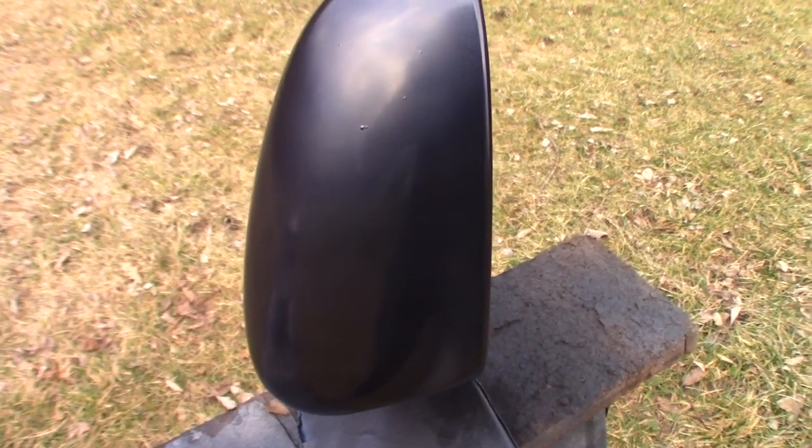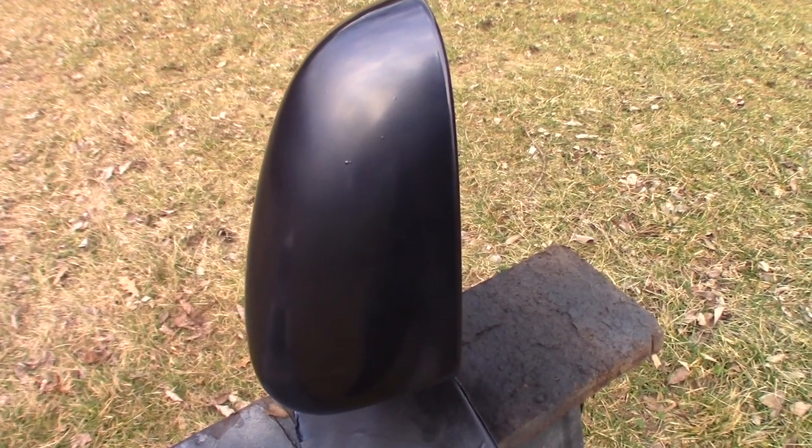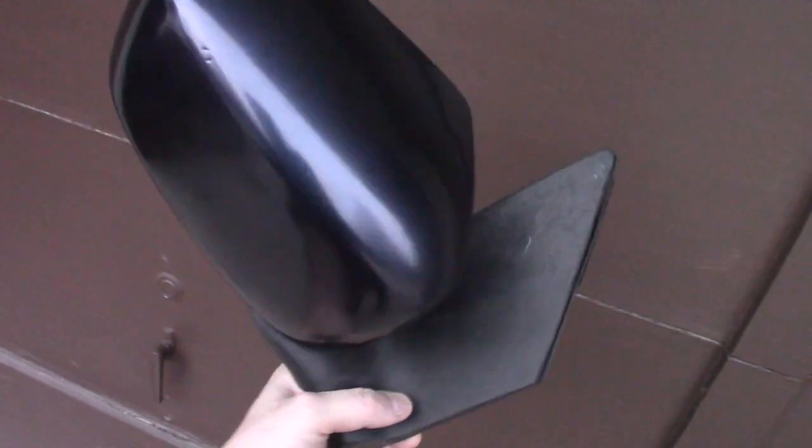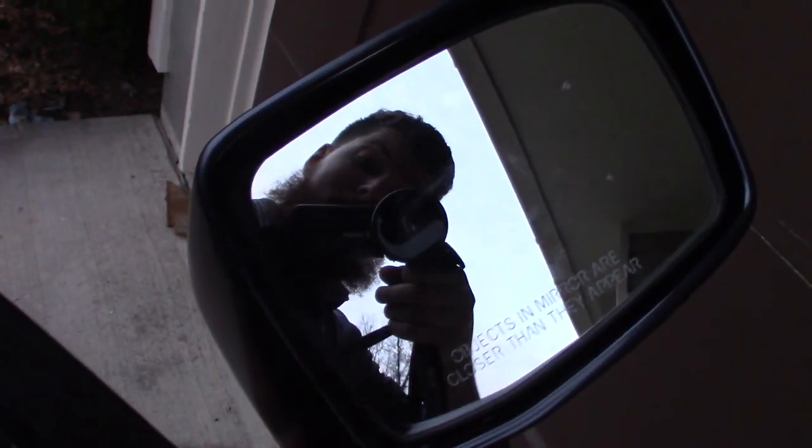Now I'm going to wait about an hour to let this paint cure a little bit before removing the tape — you want to do that before the paint is fully cured so it doesn't rip off chunks when you take the tape off. Here's the final product — turned out pretty well. This is not a bodywork video, I didn't fix every nick and blemish. But this is a really good way, on a budget, to make something match your current car and have it look good — people aren't going to notice this has been spray painted. Hopefully you guys find this video useful. Hit that like button below and subscribe to the channel. Appreciate your time.